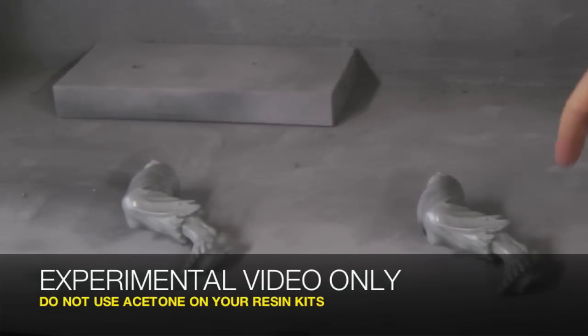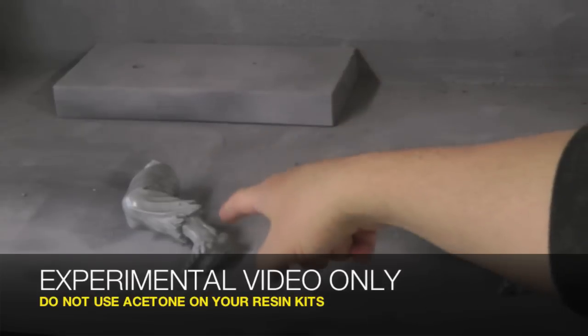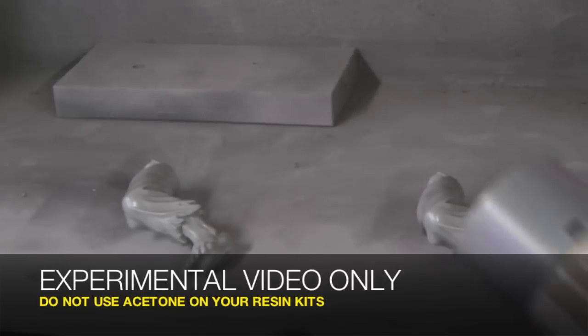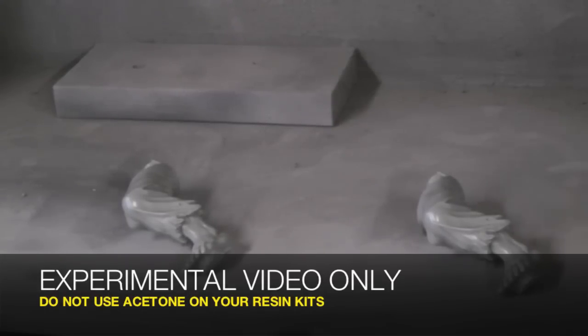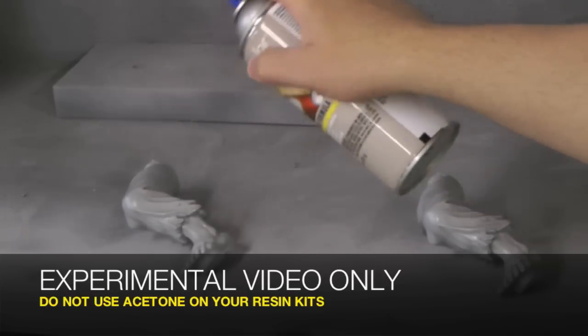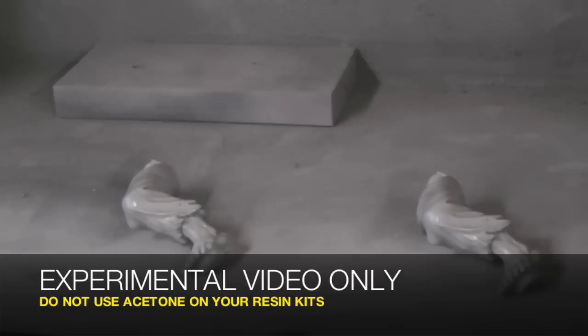So we're just going to do a test now. This right here is the acetone bath leg and this one is the degreaser. Usually I sand these down and patch them up and prime them while I'm doing it, but right now we're just doing the experiment to see how this stuff works. I have my Duplicolor filler primer and I'm just going to spray a little bit on each leg to see how well it works. Looking at the acetone one — it's going on pretty good. I don't see any kind of bleeding or bubbling. And the degreaser is looking pretty good too. We'll come back, let this dry for about an hour, and do some scraping tests.